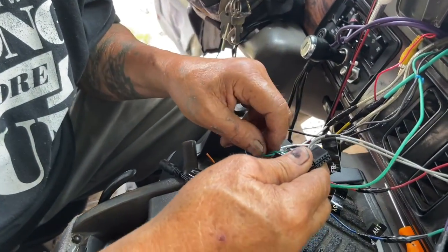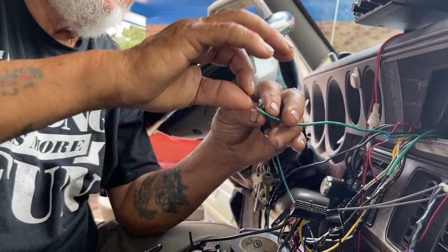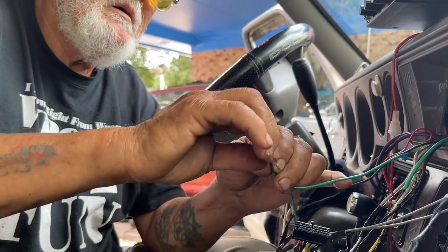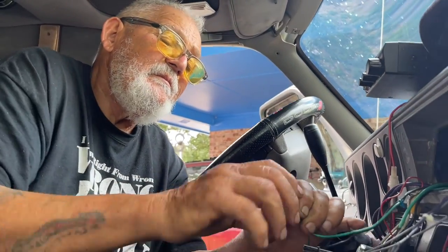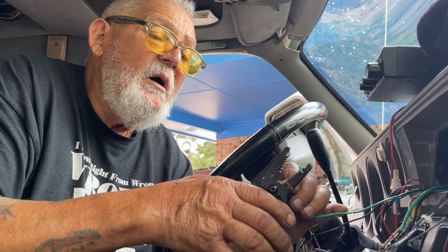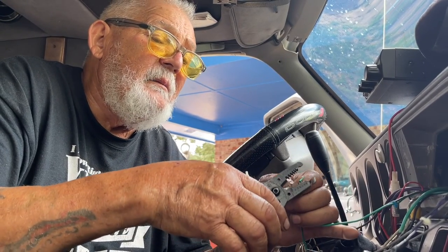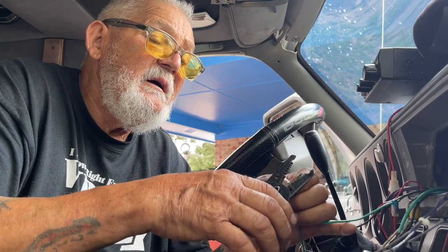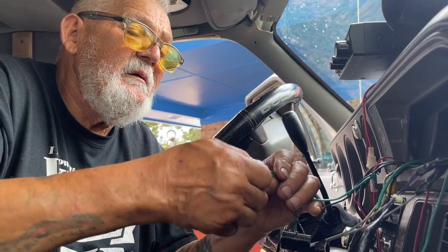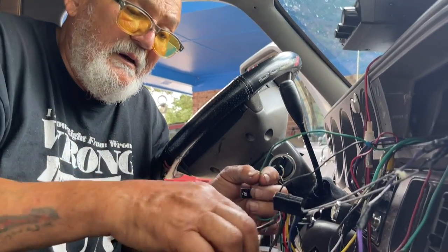The second speaker, as you can see, flat green with the flat green. This is power. The other one was ground. You do it that way, it's your way. Clip? No, I'm cutting it. Because if I don't cut it, it might cut my tape when I tape it up and it hits something in there. It could have hit the metal and create that confusion that you're talking about. It could have hit the metal and do something, see that? Okay. That's how you do it.